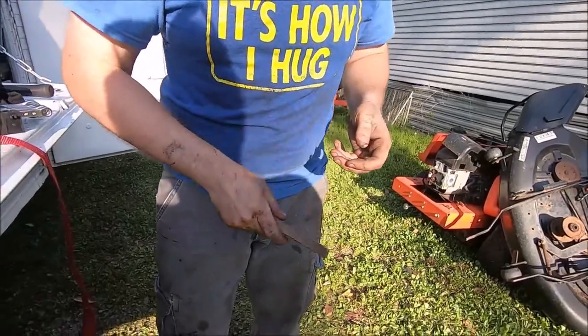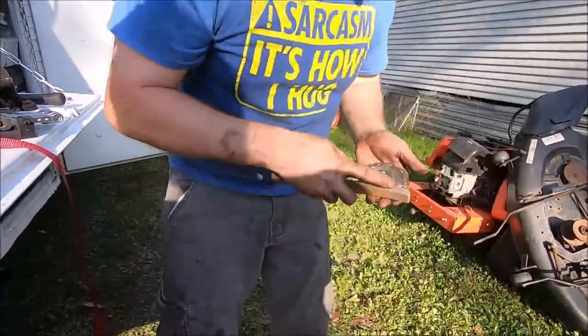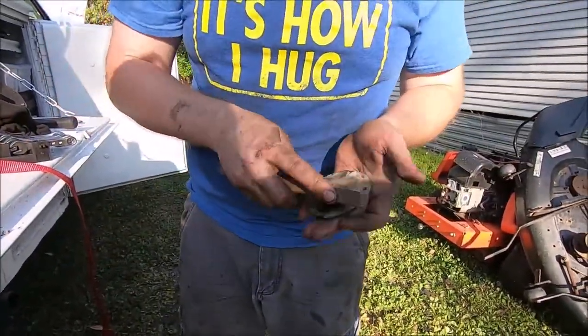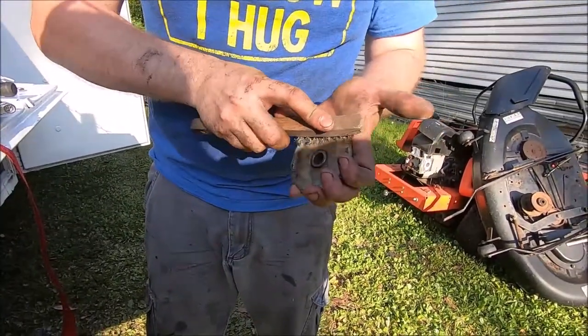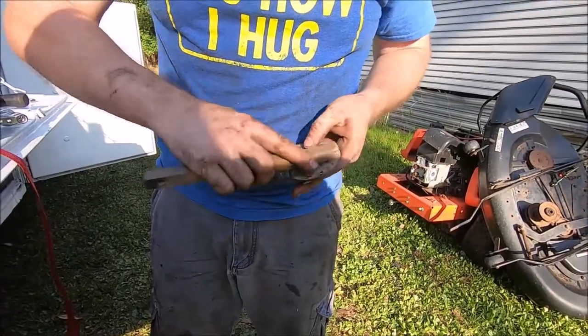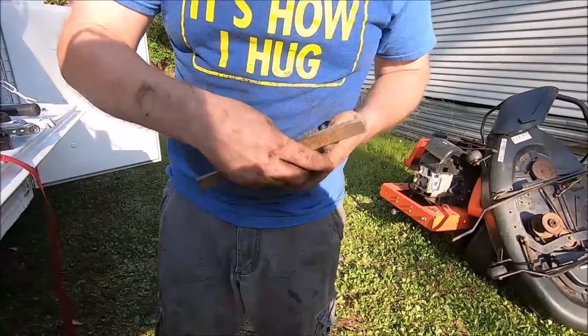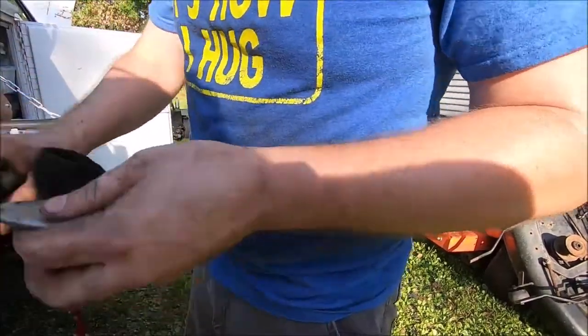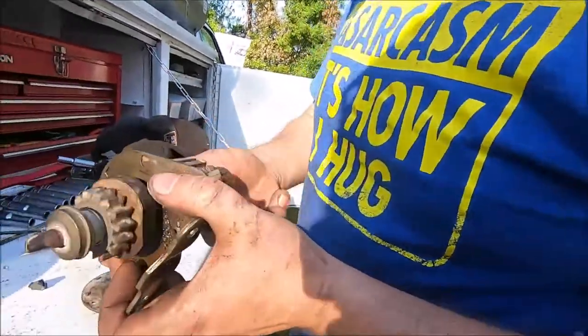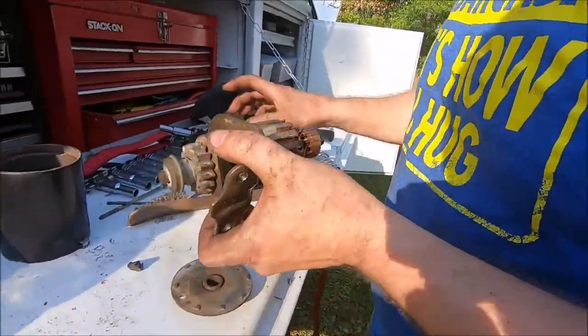I have done this before a couple times successfully. Sometimes it works, sometimes it doesn't. Key thing is, are the brushes intact, are the contacts intact, and are the bearings intact? I mean, other than, of course, your windings and everything in the motor, which are generally okay.